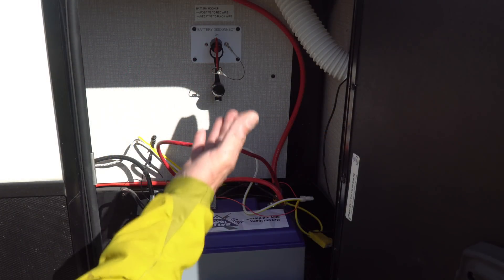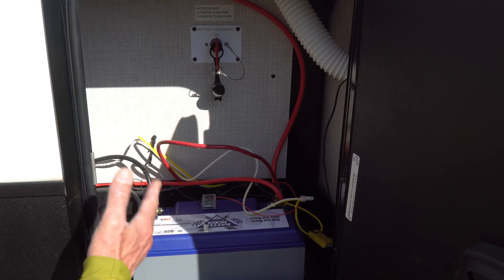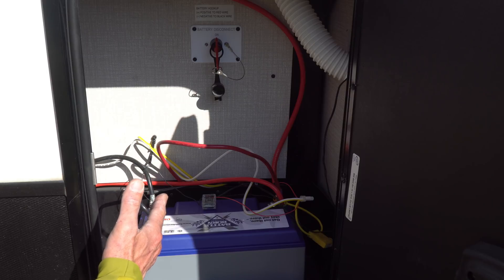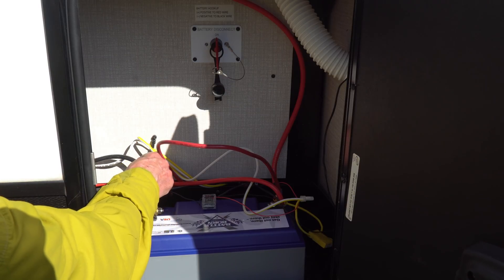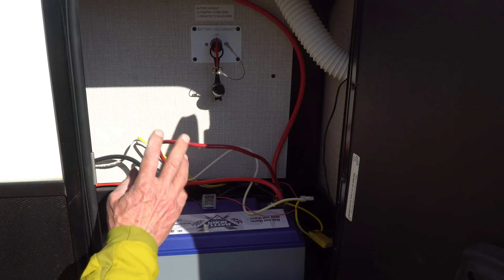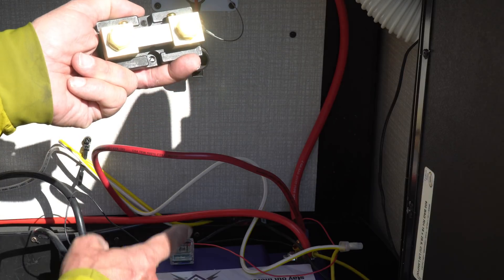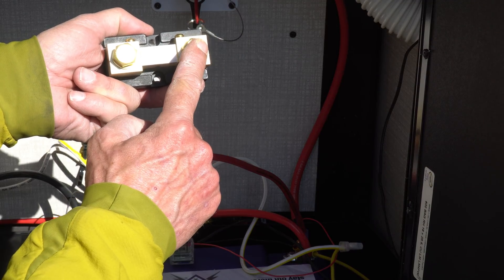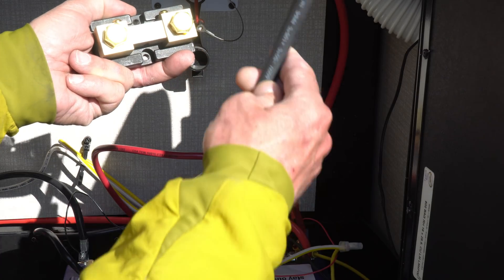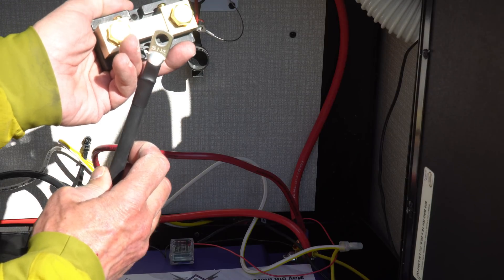You want to install the shunt as close as possible to the RV's battery bank. It's imperative that you have all loads passing through the shunt. In our case we have one cable leading from the battery to the common ground, and another negative cable connecting our battery directly to our Xantrex power inverter. We're going to need to connect both of those cables to the load side of our shunt to ensure that all loads are being accurately measured. Our first step is to take those two negative cables that go to the loads and tie them off to the load side of the shunt, then take a short 12-inch jumper and connect that to the battery side of the shunt and to the battery terminal where the loads are presently connected.